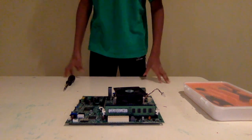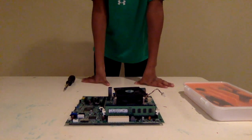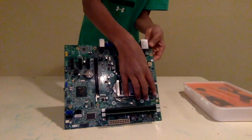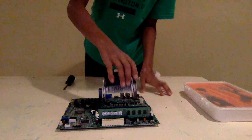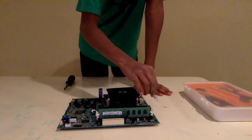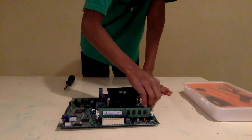We're back. Just so you guys know, this wire will be coming out of the heat sink. I'll connect this part to the motherboard — it will be a four-pin connector. Align it so the wire output is closest to the pin, and plug it in. Parents, don't worry — you won't get an electric shock if you're trying this.